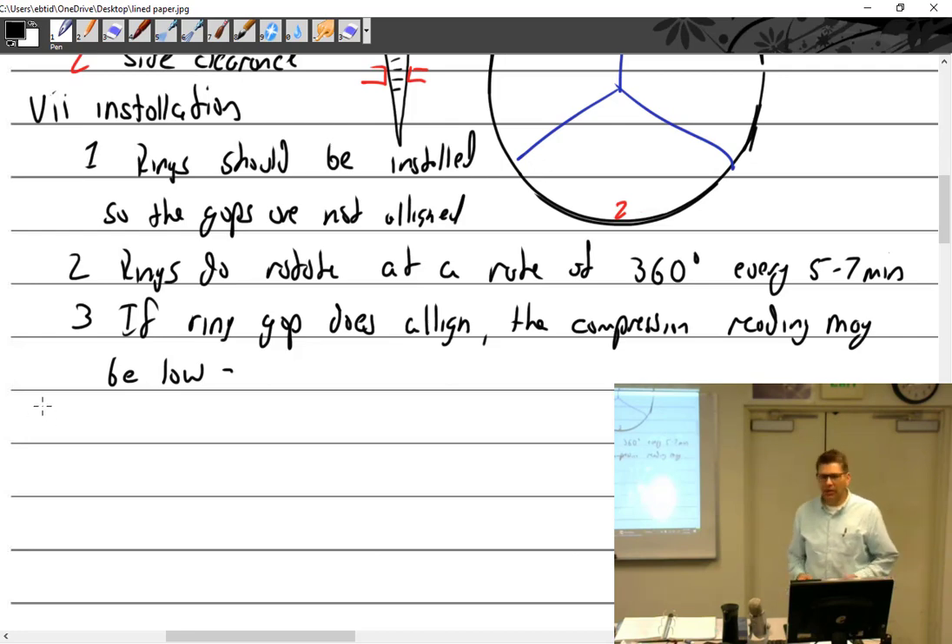The big rule: if you have a chrome barrel, never use chrome rings. You'd think this wouldn't come up, but it actually happens. For example, someone has a cylinder fail away from home, a buddy brings a spare cylinder, they swap it out leaving the original rings on the piston - but the original cylinder was plain steel or nitrided and the replacement is chrome. So the chrome rings go into a chrome barrel, which is really bad and will make a mess of everything.